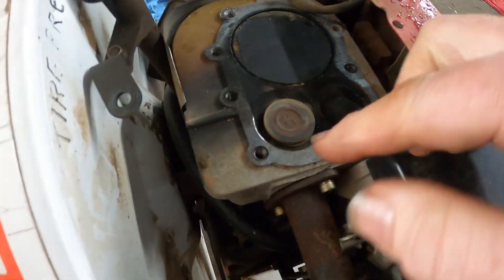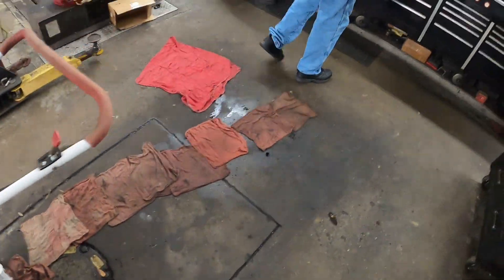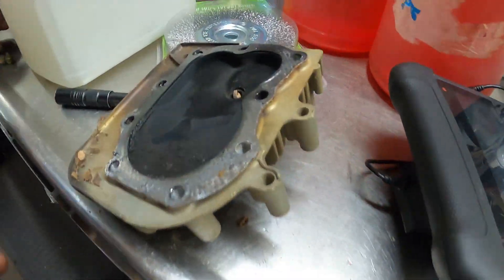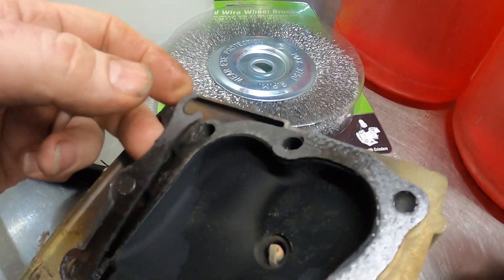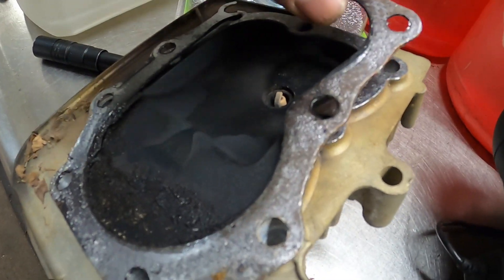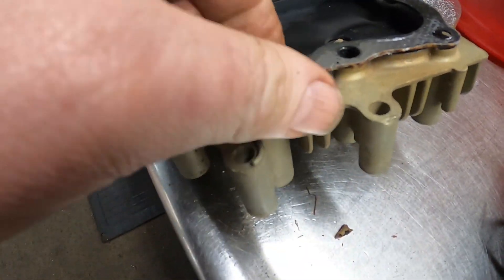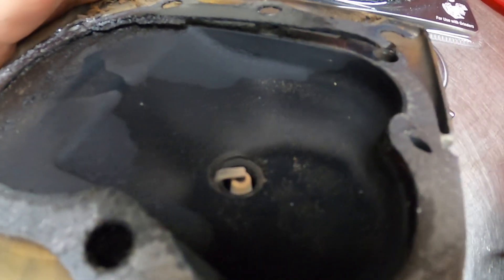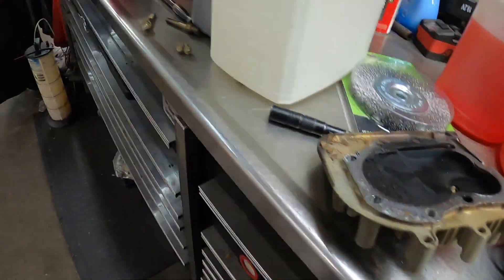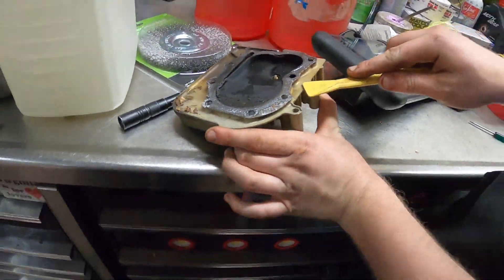The piston is carboned up — that looks good. We're going to get a scraper and scrape all the pieces off and get this head gasket off. It's just a really cheap head gasket. You can see the piece that's missing — that's where it was blowing out. The spark plug looks nice and brown. Let's get this all cleaned up and I'll go online to find the torque spec.